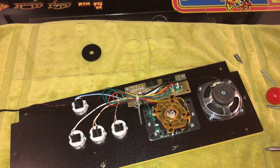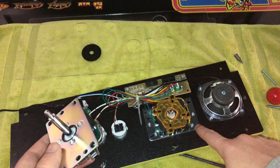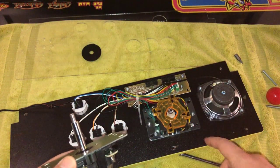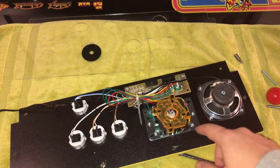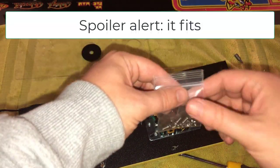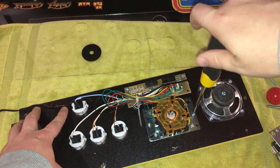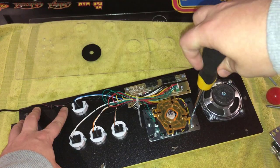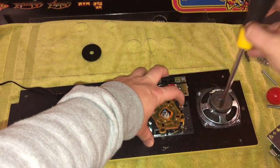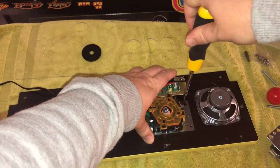What I'm going to do today is connect this joystick to this mounting plate, so I just don't have to drill any new holes. The Sanwa JLF sticks fit in this mounting plate — they just require different hardware. The first step is going to be to remove the mounting plate. Unfortunately, Arcade1Up likes to use a lot of glue, so even when all the screws are removed, if your build was like mine it's going to be glued in place. I'll show you how to take care of that.